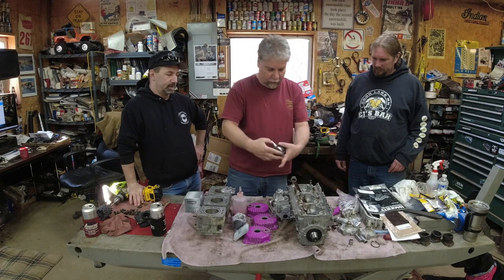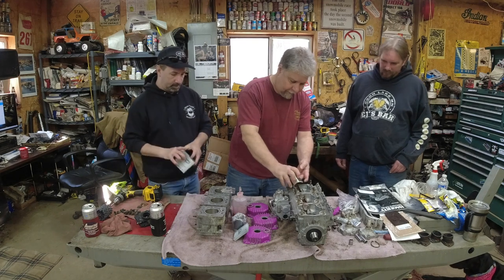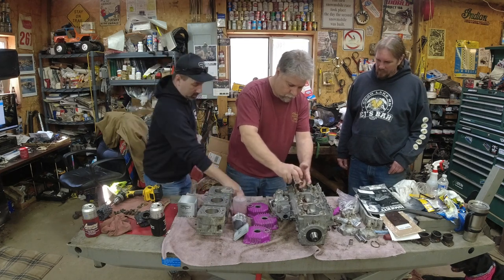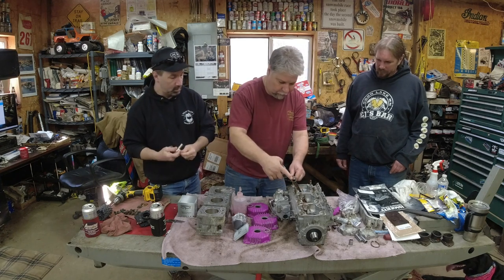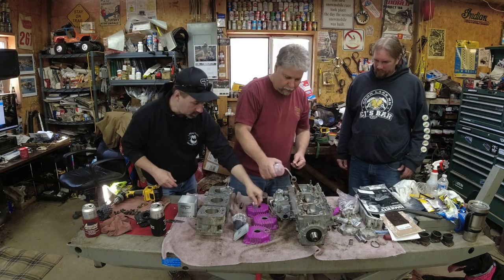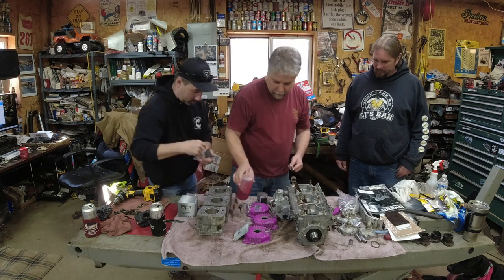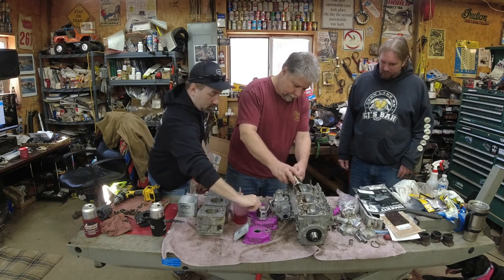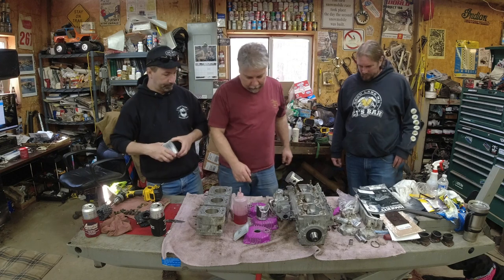Guess I'll get this started a little bit. Boy, that slides nice. And it's just kind of braille it through the hole. Now it doesn't want to go all the way through. So what's up? Does it fit through the pin, through the bearings? Oh, really nice. Really good fit through the bearing. Let me give it a little more oil. Can't really over-oil it. It'll just come out the exhaust. All right, one more try. There it goes. All right, so we'll get the clips in.